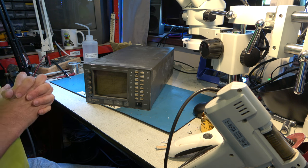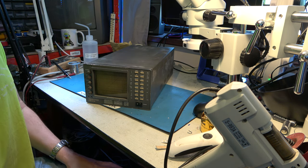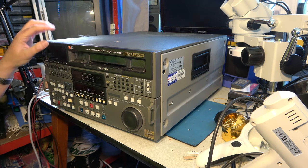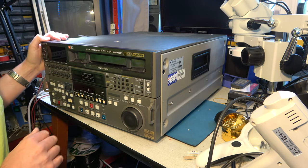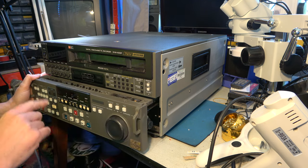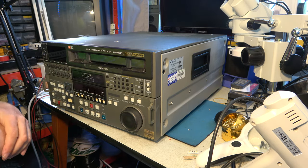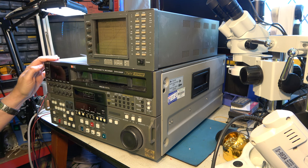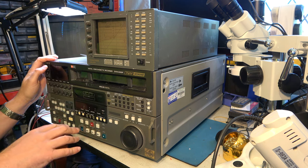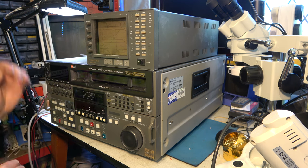So what digital equipment do I have with an SDI digital output that can feed this, and analog inputs I could connect to other equipment? This tiny little video recorder will do that job — the DVW-A500P. This is featured on my channel before when I did some minor repairs, such as replacing the pinch roller. It's a fantastic digital Betacam machine. It has SDI out and analog inputs, so we could use this for providing an analog source for our vectorscope. When you switch this on, you only have to press a few buttons and it will output color bar patterns to the outputs, including the SDI outputs.